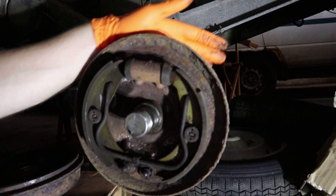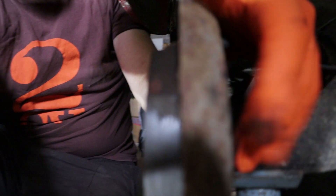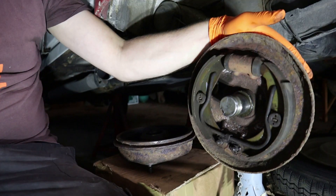One of the adjusters is rounded and seized on the back of the drum. It's okay on this side, but on the other side I've got a problem. I'm rather hoping I've brought the adjuster with me. Daris at RetroSpec kindly sent me one in the post at a slightly reduced rate, so cheers for that. You've got to grind them off to refit them. I have a horrible feeling I haven't brought it with me - I remember looking at it in the bedroom, because the bedroom is currently my office. So I might not have it, but I can still get this side rebuilt while I'm here.